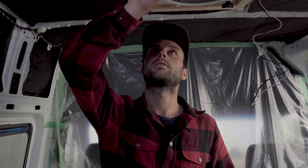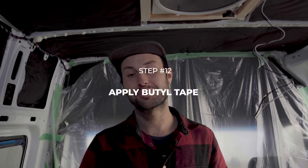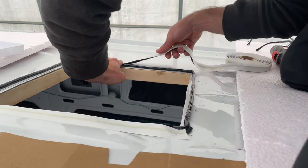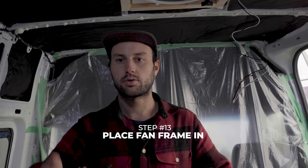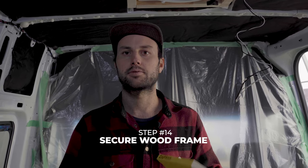If you have any burrs or it's a little too tight, use an angle grinder to smooth it out. After grinding the edges, paint them — it's super important to prevent rust every time you put a hole in your van. Once the edges are dry, place your fan into the hole and pre-drill all the screw hole placements through the metal so the screws go in smoothly into your frame. Then remove the fan and lay down butyl tape along the whole edge of the hole.